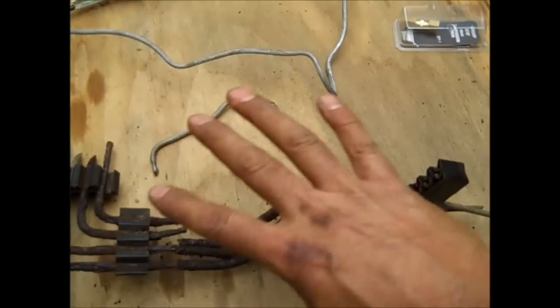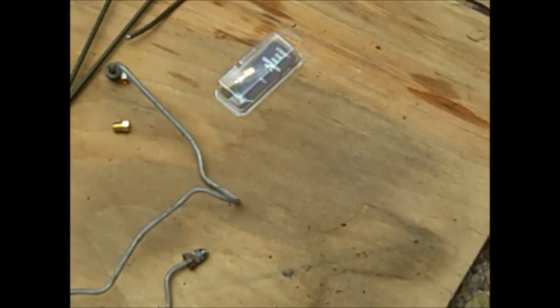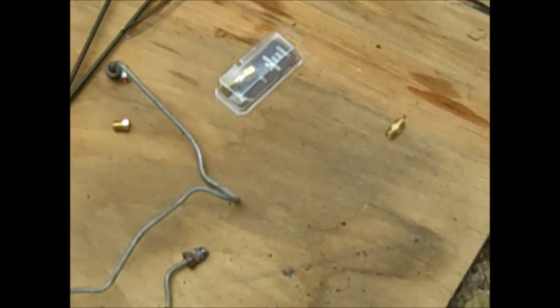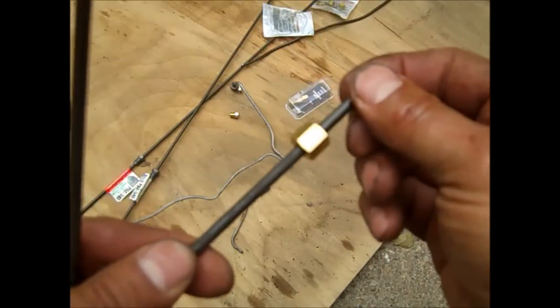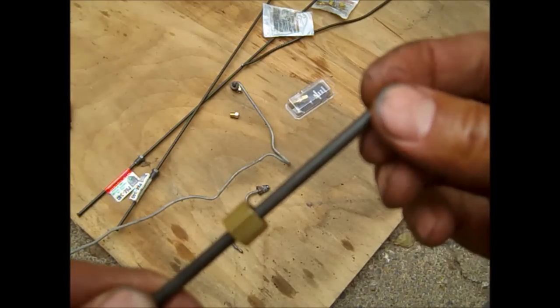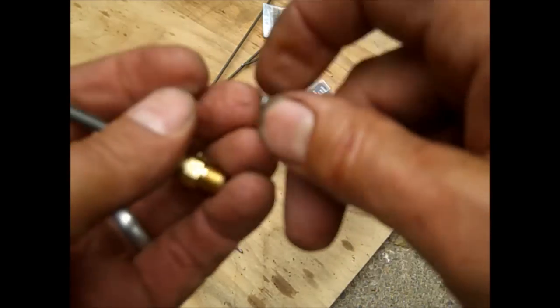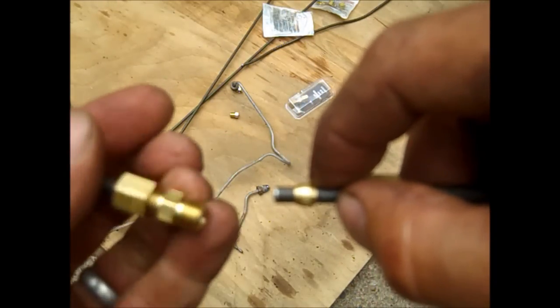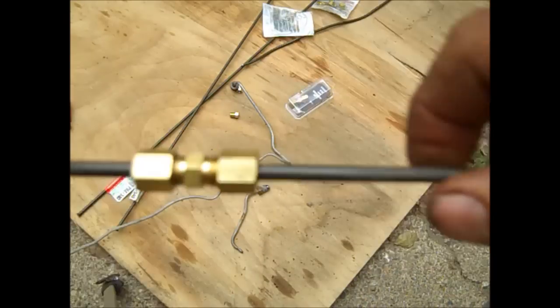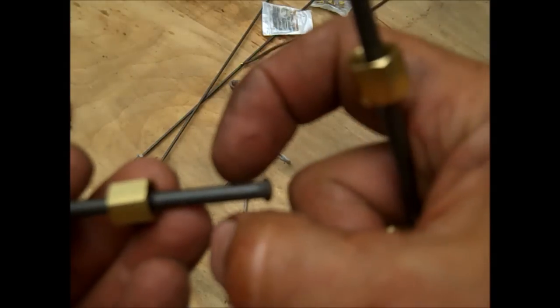I already cut all these off and respliced them. Now I'm going to show you how to fix that one leak with simple splices. There are two very common unions used for splicing brake lines: one's called a double union flare and the other is called a compression joint. A compression joint works like this: take your cut end, put your compression nut over it, then put your compression fitting into your union — same on the other side — bring it together and tighten it down. That fitting crimps the tubing so it holds on, and your splice is complete.